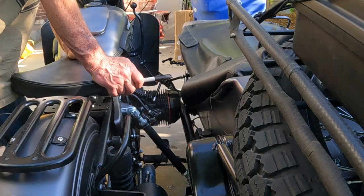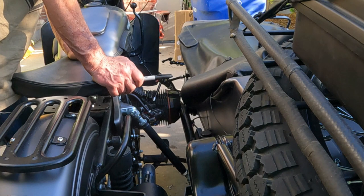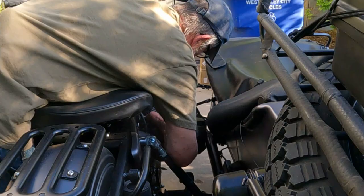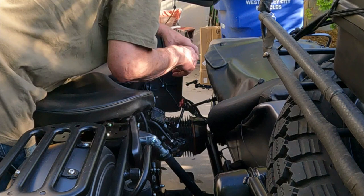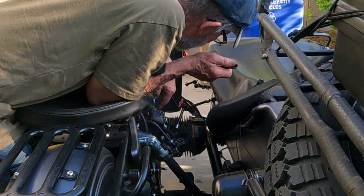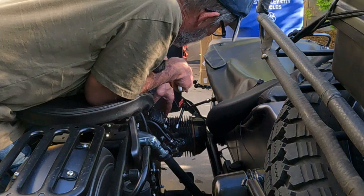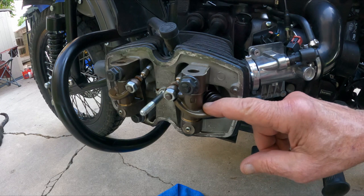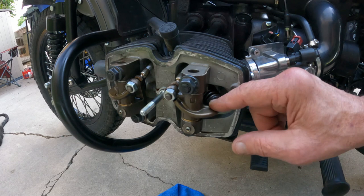I'm going to check and make sure that that mark is correct. It's definitely a challenge to find it, and it's a challenge to rotate the engine over in small enough increments to find it. So I am going to mark it — I've marked this now with a Sharpie so it'll be easier to find next time. When you're done adjusting everything, just put the plug back in. You have to do this twice: this mark is for the left-hand side and you need to rotate it around one more time to get to the right-hand side. In my opinion it's much easier to wait till the intake valve closes and then adjust the valve, than trying to find the timing mark on the flywheel.